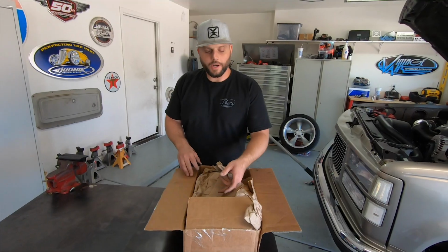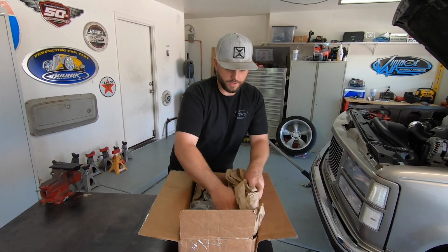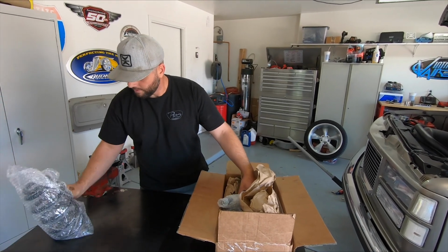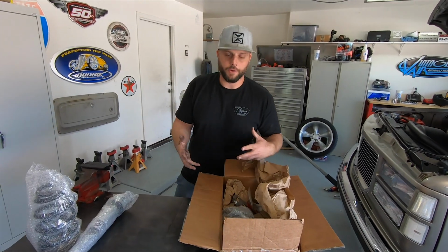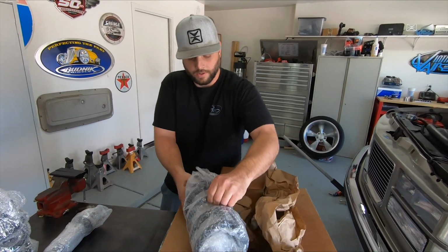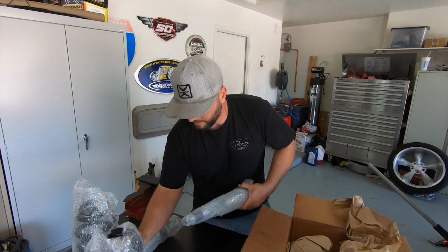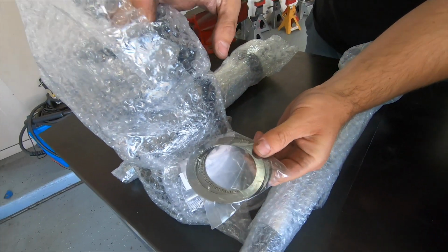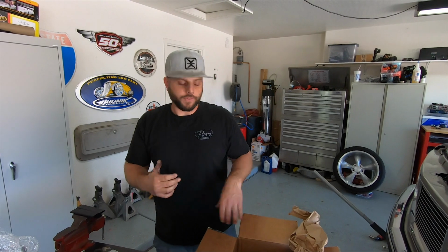the spring pocket. All right, so this is the Aldan coilover setup. This is how it comes out of the box. Coilover setup. We'll kind of show you how these fit in there and how they work with the OE arms. And these right here are the thrust bearings. So this will make it really easy to adjust once it's on the truck. You don't need that, that's a nice add-on because it'll make it really easy to adjust them without taking so much weight off the vehicle.